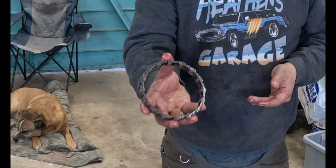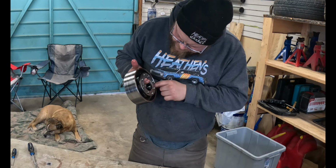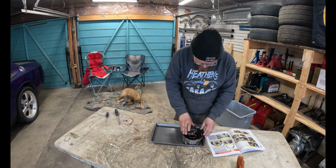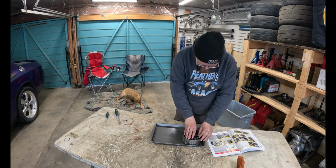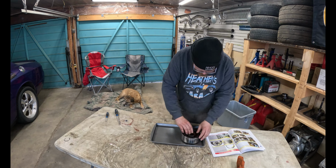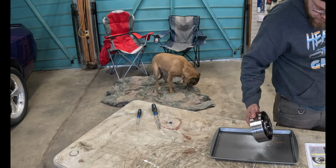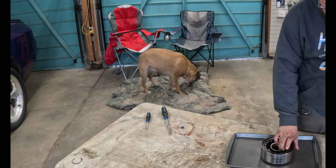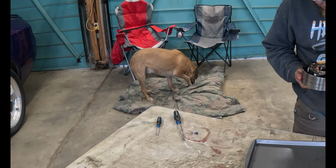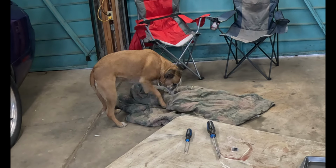That's a sprag. Now I think this is actually called a roller clutch, but I didn't know any better at the time, so forgive me for every time I say it wrong. It acts like a one-way clutch. It's really badly pitted over here, but I don't think that's a spot that matters. You're supposed to put a new one in. I think it's a fight to put the thing back in. I think it goes one way and doesn't go the other way. Doesn't seem to go either way, if we're honest. That shouldn't have belonged to that.